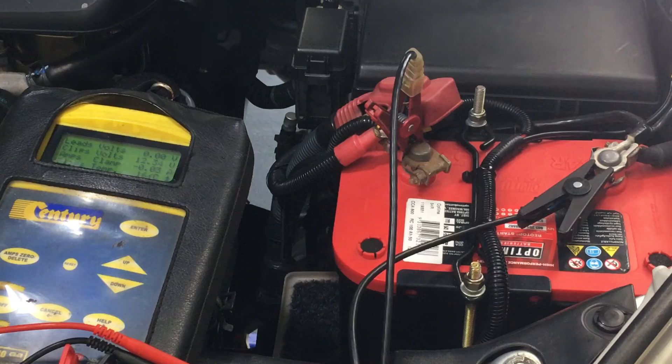If you haven't got a battery load tester, which most people haven't, all you've really got to rely on is voltage readings, which is pretty simple. Everybody can own, and probably should own, at least a small cheap multimeter. And if you're away on a trip more than 100k from home, you should probably take it with you as part of your spare parts.